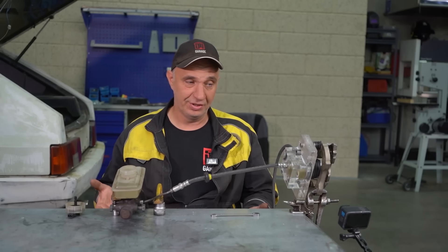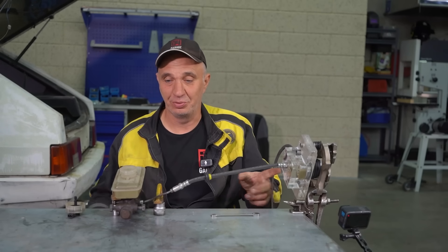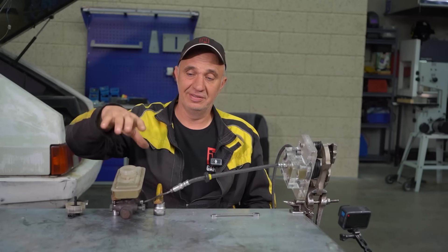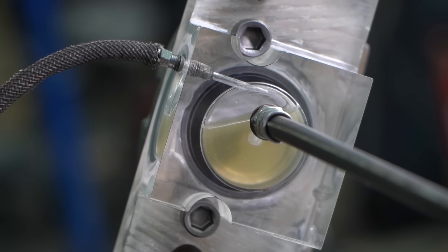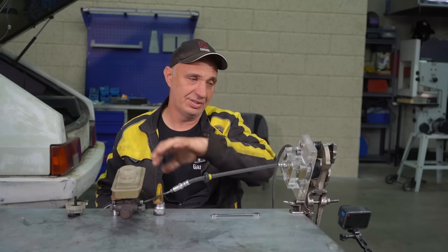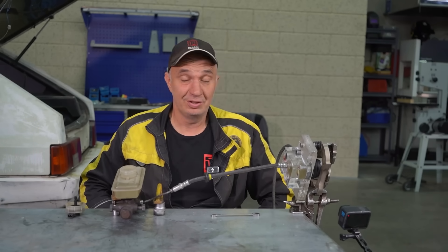So we've just simulated the brake bleeding process, which you need two people to do. But another popular method, and one that I actually haven't tried myself, is gravity bleed. That's when you got the reservoir placed up high. The process involves undoing the valve through which the air escapes — the air finds its way out and the brake fluid fills the system. Let's try this method out and see how effective it is. Let's go.